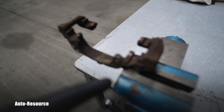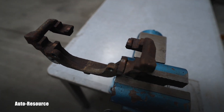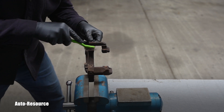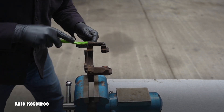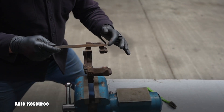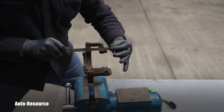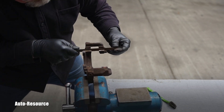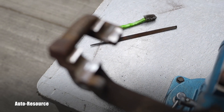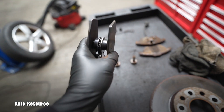Now for this brake carrier — this is a really important part because that's where the brake pads are traveling in these channels. We normally just clean it with a wire brush, but I don't think it will be enough in this case due to the rust. I will grab a fine file and gently clean the surface — not trying to make these grooves bigger, just cleaning. Here you are looking at the before — I haven't touched that side yet — and this is after. The pads should be sliding on this perfectly with ease.